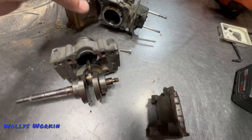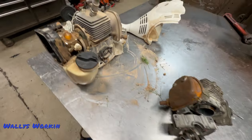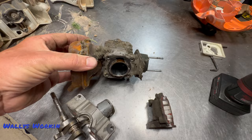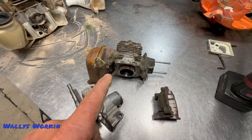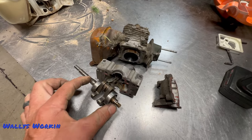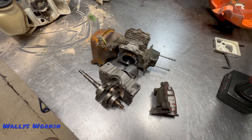Piston and cylinder on these things — the cylinders are really, really good. The chrome they use in these holds up extremely well. If we get a piston that's burned up, we can usually hone the cylinder and it'll clean up no problem at all. So the cylinders are very robust — they just never seem to wear out. Very rarely do I see them wear to where I cannot rebuild them. A lot of times I just have to put a new piston kit in and a seal kit with the crank seals and gaskets. The connecting rods, crankshafts, and crank bearings all hold up well.